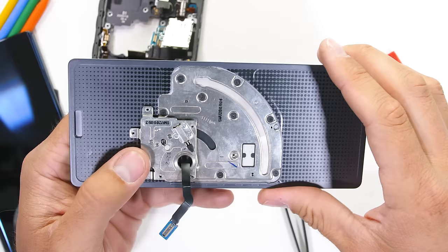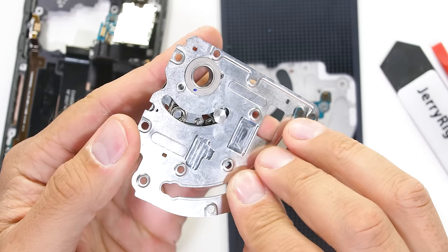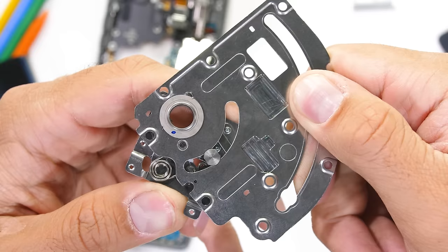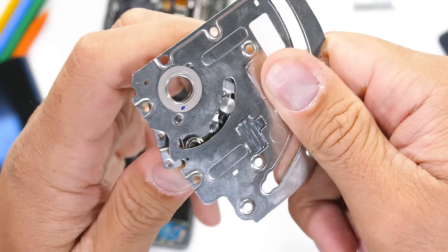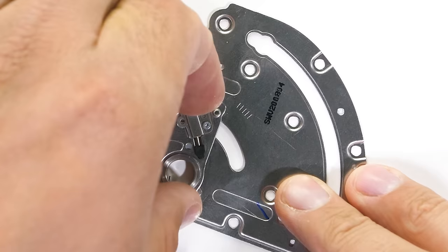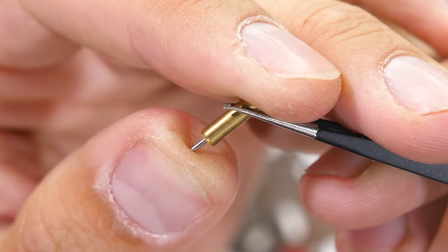There are nine black screws holding the hinge to the super thin top display. Once those are gone, we finally get our full complete view of the LG Wing hinge. The rest of the hinge components are riveted together, because what's left inside are two pretty powerful springs — one that helps the phone open and hold it open, and the other that holds it in the closed position, both equally balanced so that the swiveling motion is easy. The large hole in the center is for the ribbon cable. The two curved sections are for the double locking mechanism that keeps the screen from opening too far in either direction. Our itty-bitty hydraulic damper is held in place with three tiny screws — it's the same technology that keeps a screen door from slamming shut, now inside a cell phone.